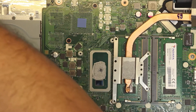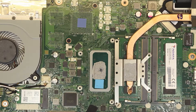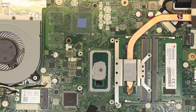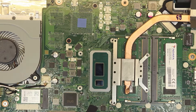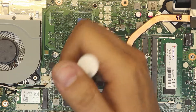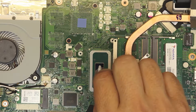To fix the problem, grab yourself some thermal pads — just like this one — and place it right on top of that second die. About three to four millimeters of thermal pad thickness should do the job. Before putting it on, clean up the old thermal paste. Once it's cleaned, grab your thermal paste and apply a drop right on the main die, and place the thermal pad on the second die.